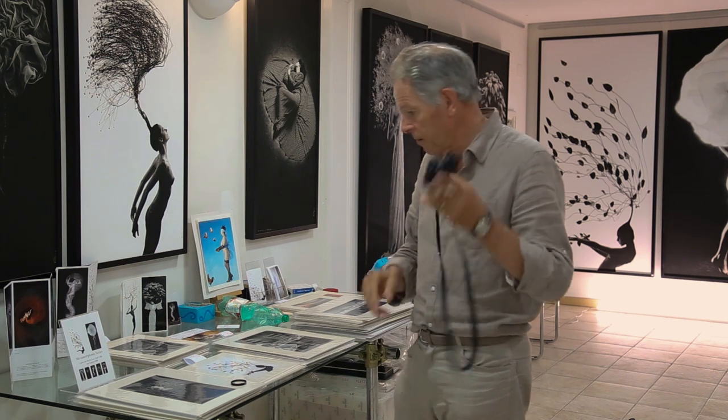We take this camera now, and the first thing is you can't get the zoom out if it's stuck. The only way to do it is to buy yourself a UV filter, or a polariser, or something to screw on the front of the lens. That means that when you turn the camera on, just give it a pull and out it comes. You can't clean it until you've got the zoom out.